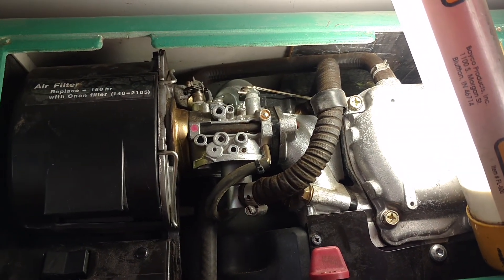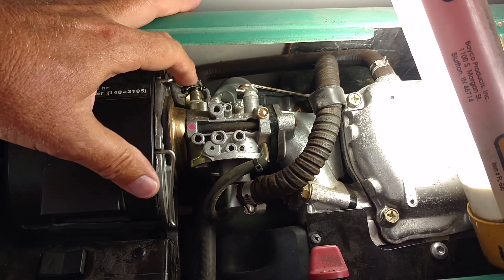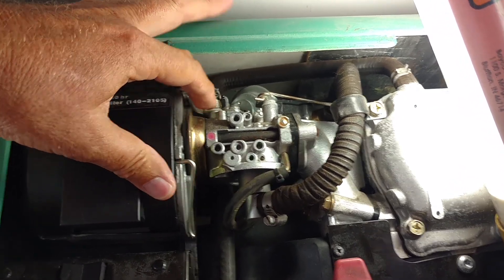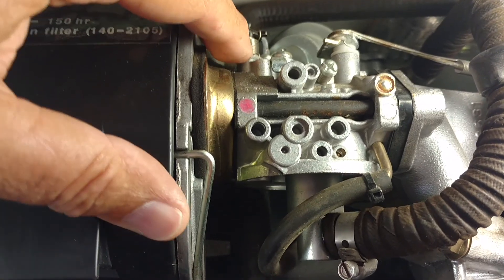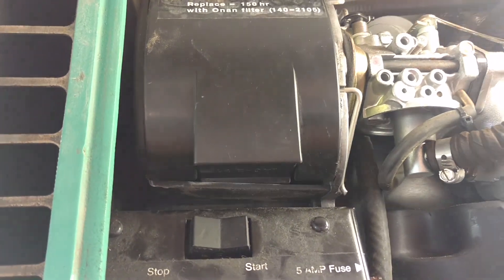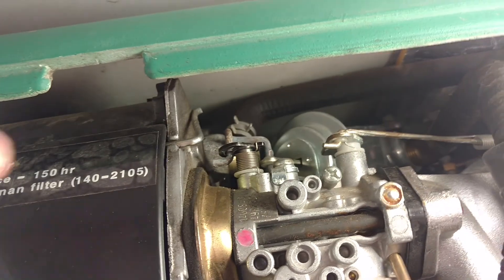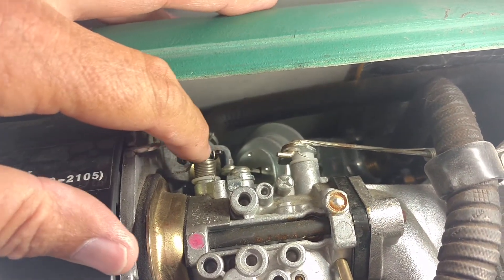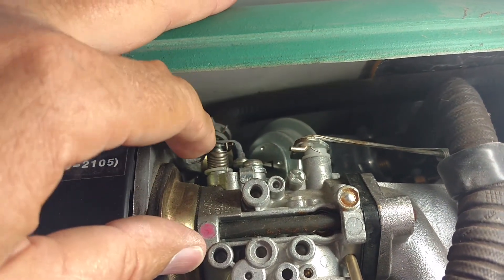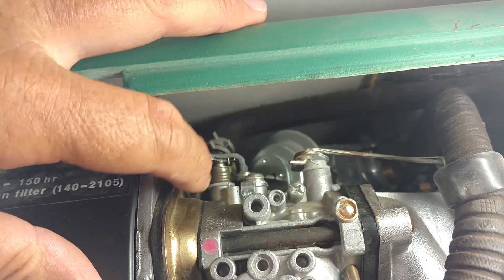After I got home I started looking at it trying to figure out why it wasn't starting, and I realized that the choke — this is the top of the choke arm here — has a little coil spring wrapped around the choke shaft and it hooks on the crank on the top of it to pull the choke closed. And you can see it snaps closed quite nicely when I do that.